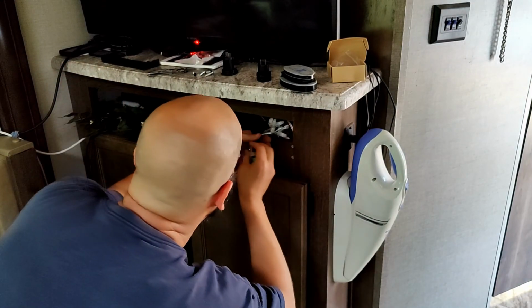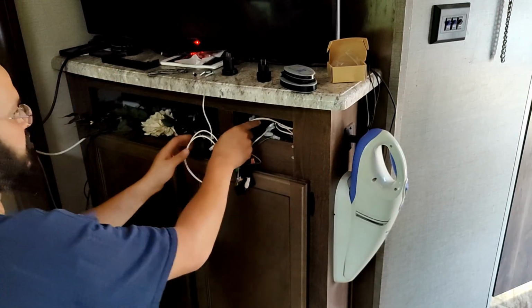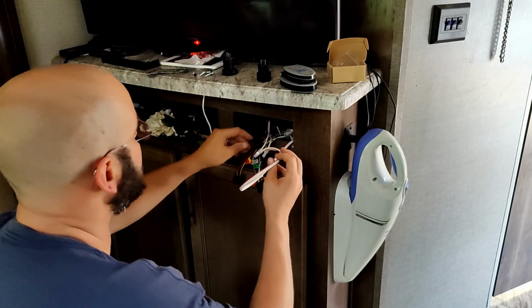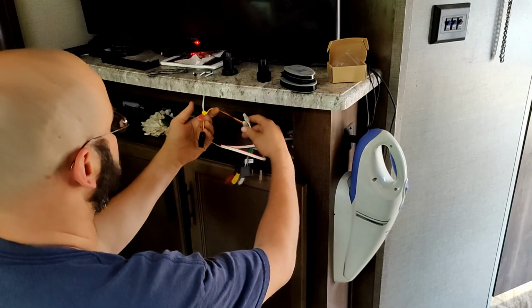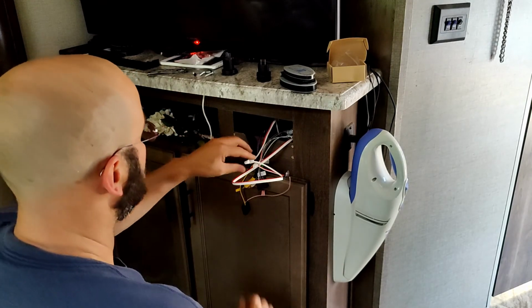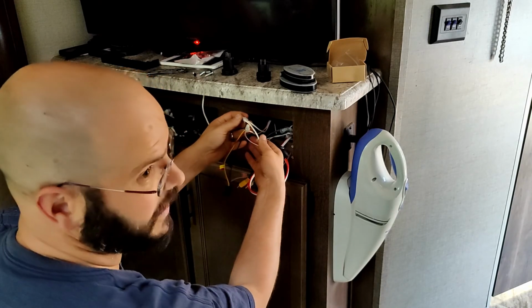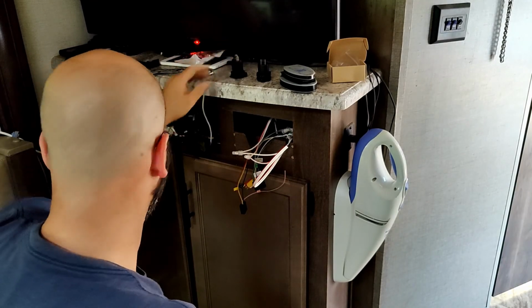And you can see I've got access to the power wires now, because they're spliced over here to fire this up. They're spliced back here to fire the antenna amplifier, and they also are tied into the power for the radio. And the nice thing is, the red line is hot, white is not. So I'll just splice them into here.